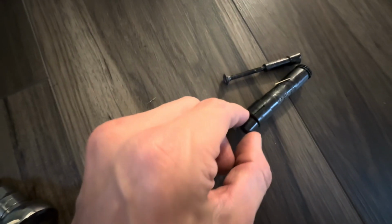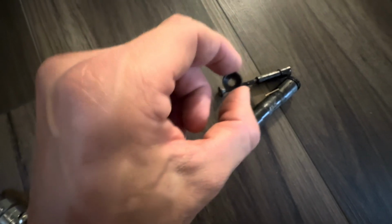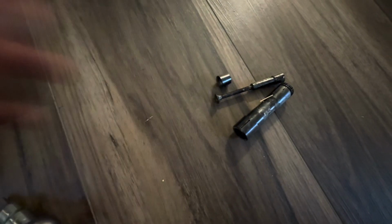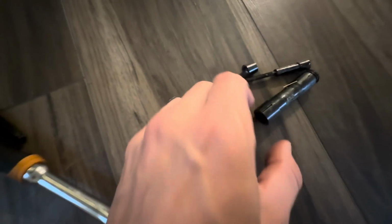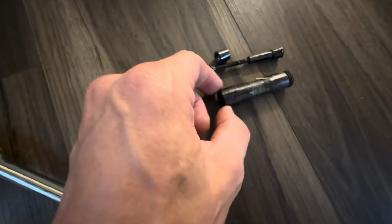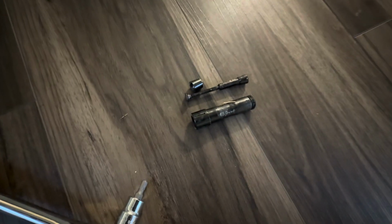Next, this cup was embedded in there and it was stuck pretty good. The manual says that you need a 5mm to put in there and try to wedge it out. I could not get a 5mm. So instead what did fit was a 3/16, and that fit in there, and I kind of loosened it, and then it just popped out. And then the lock ring takes a 6mm, and that turned out, but it's kind of hard to get it out.